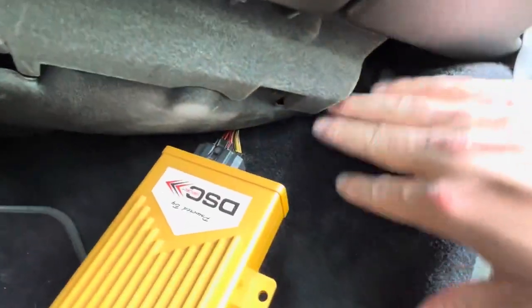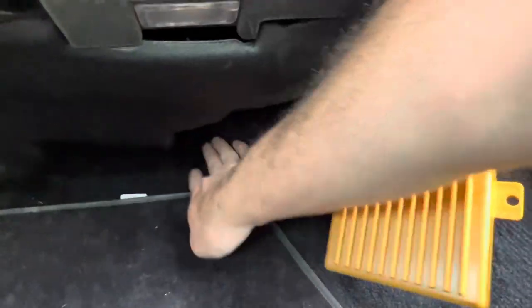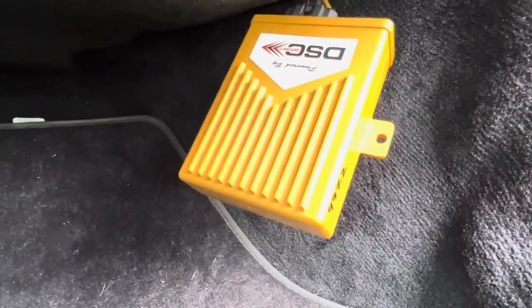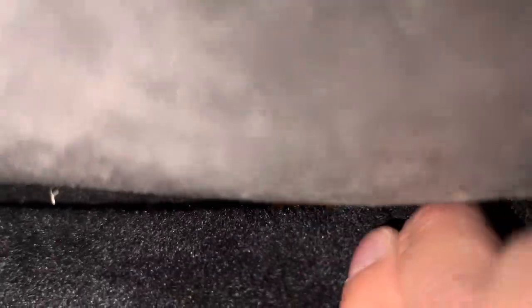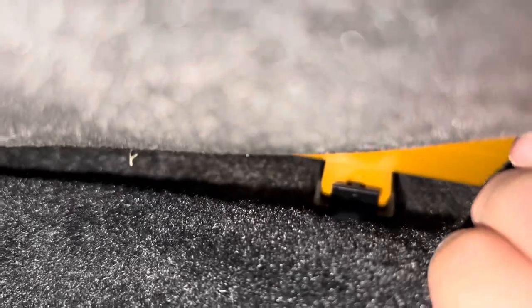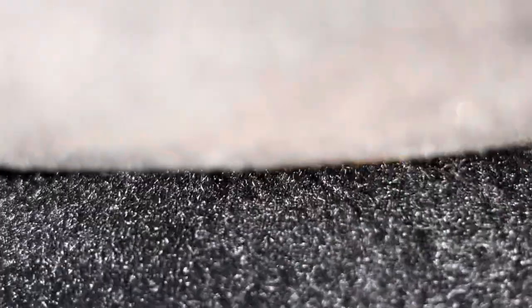I was careful pulling on this because this part feels like it's glued, and all the back wall down here feels glued too, so I only pulled it just enough to get the box out. Quick tip: there's a bottom tab and an upper tab on the unit. You really have to get that upper tab in first — it has a locator hole and a tab — then do the bottom one.